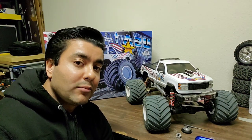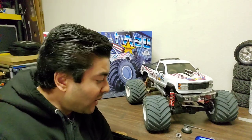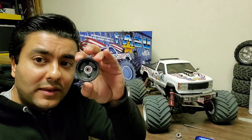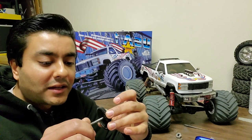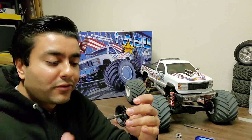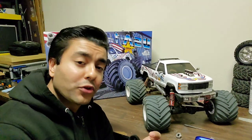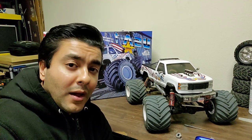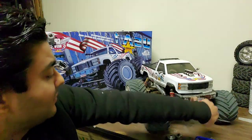When I was putting the first gear one-way bearing on, I could really feel those gouges affecting the needle bearing. I knew if I reassembled it that way, my new needle bearing — the new parts I just got for the second gear — would also fail. So what I did is I took a small file and it seems to have worked.